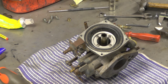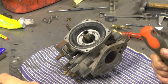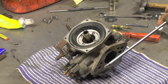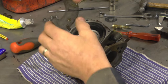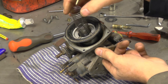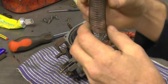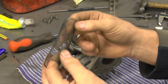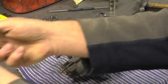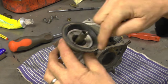There's the dashpot spring — it's one of those things you can keep bouncing about for ages. All that is is a very soft return spring to push the piston back down. When the throttle is on full, the piston lifts, and when you take your foot off the accelerator, that spring pushes it back down. It's a very light spring — don't get tempted to pull it apart thinking you'll give it more strength. It's a progressive spring and it only needs to be lightweight, so resist the temptation.